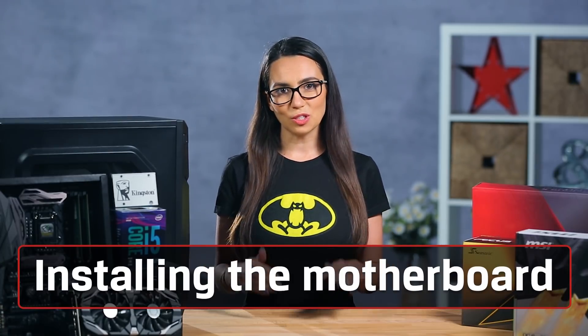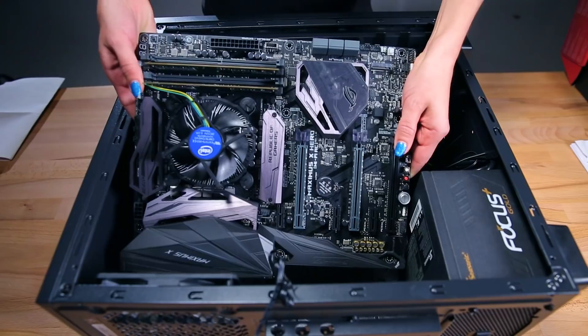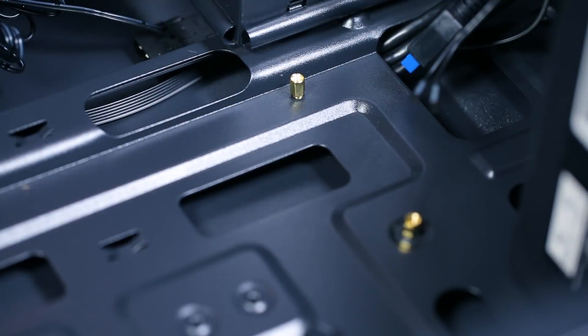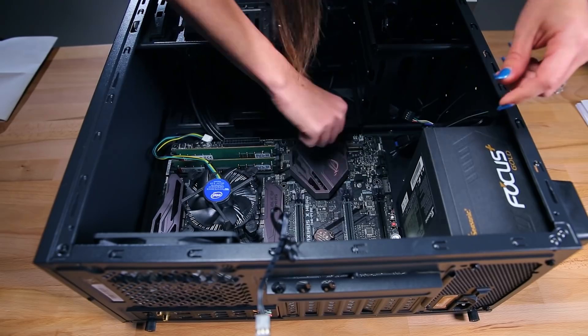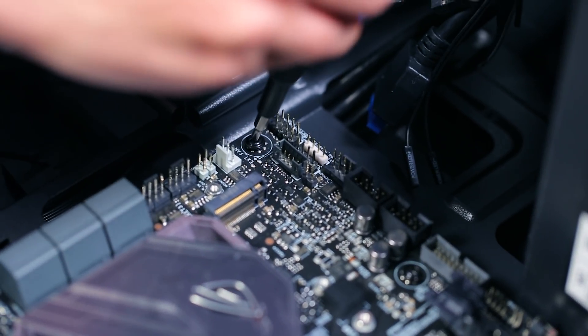Now that the integral components are installed on the motherboard, it's time to install the motherboard herself. Most cases don't come with pre-installed risers — these keep the motherboard from directly touching the metal of the case. By placing your motherboard inside the case, you'll see which holes line up, and that's where you should screw in the risers; they should have come with your case. Gently slide in the motherboard, pushing the rear panel ports through the I/O plate, then lay the motherboard on top of the risers. The screw holes should align, and you should be able to screw the motherboard in. I recommend only screwing halfway until you know you've got it right. Also, this is delicate stuff, so don't over-screw.